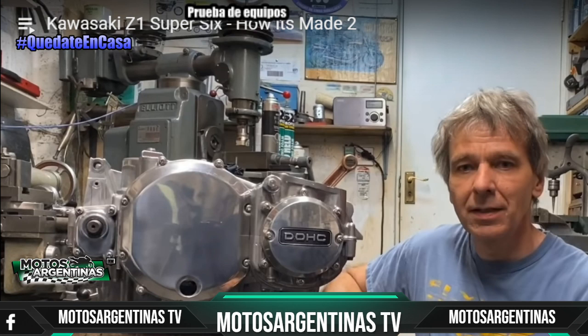With the piece trimmed to size, I clamped it to the actual engine casing using a piece of square steel and 2 clamps, then TIG welded. I actually tacked it in place with a couple of TIG welds on the engine with it all bolted up, and then transferred it to my vise to complete the weld. Once the welding was complete, I transferred the sprocket cover back onto the engine and did up the 4 screws tight. Then, using my hammer, I gently teased the edge around so it matched the profile of the crankcases.